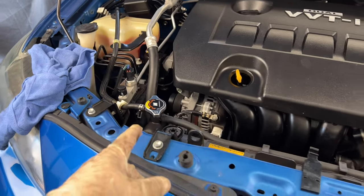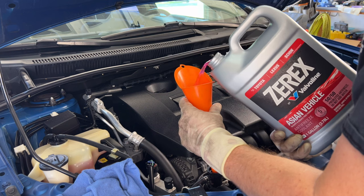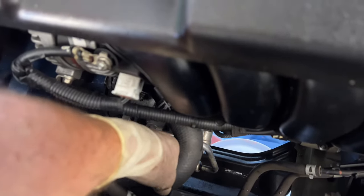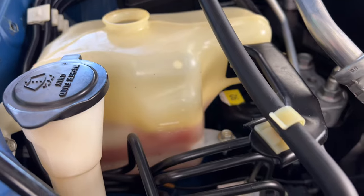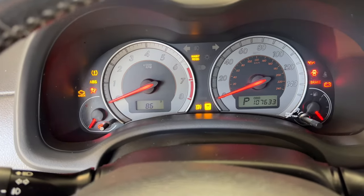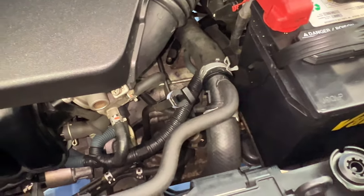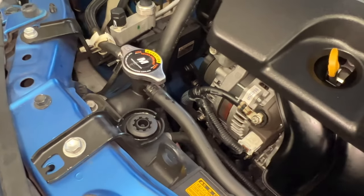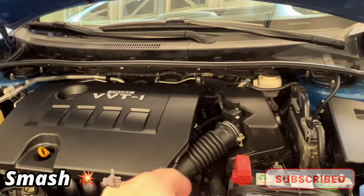Now a couple more very important steps. Add your new radiator fluid — leave a little air gap and stop occasionally to burp the hoses by squeezing them; this helps get air out of the system. Make sure your reservoir is almost all the way full, and check it after driving. Once the engine is fired up, inspect the whole engine area where you were working for any leaks. After that, take it for a test drive to make sure everything works.